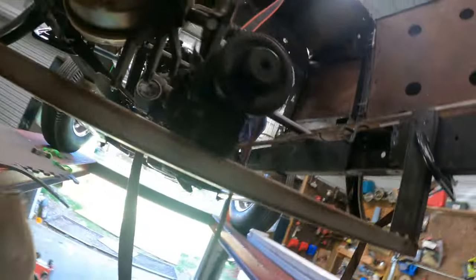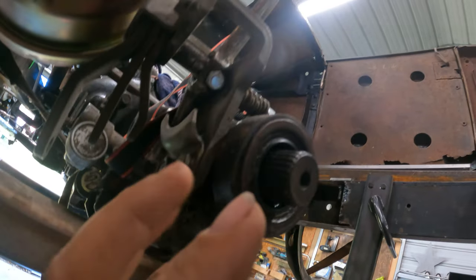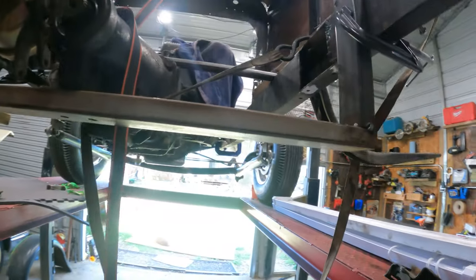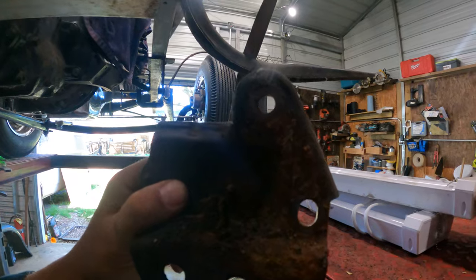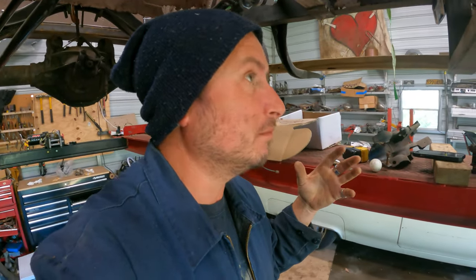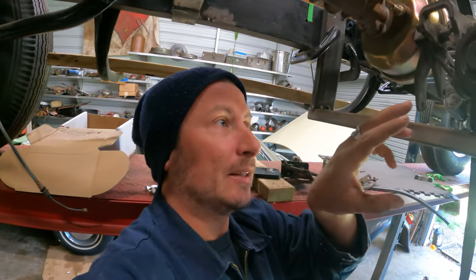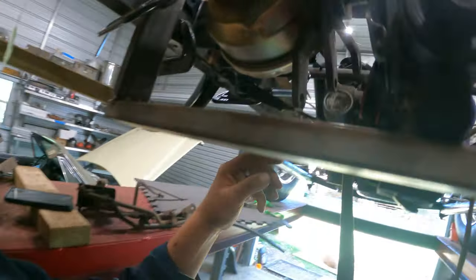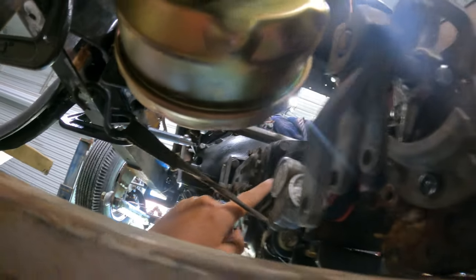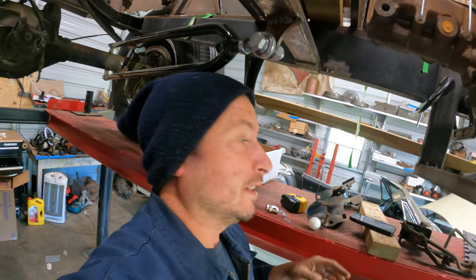So, first good sign is two out of the three bolts lined up. I have no idea what transmission tail shafts would have a similar pattern, but the original bracket that I took off was only two bolts. Hurst has all sorts of different mechanisms, from U-bolt styles that wrap around the transmission to ones that use these bolt holes to ones that use these two bolts on the transmission case itself. Short version is we can make what we need if this thing can work.